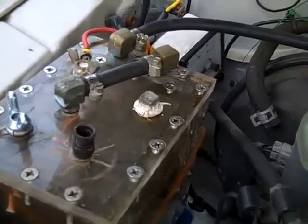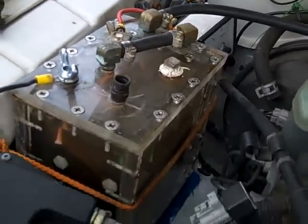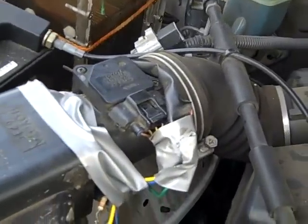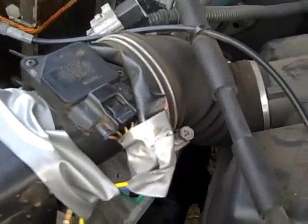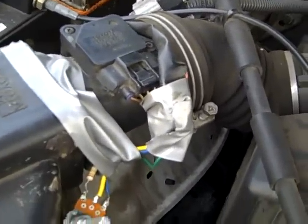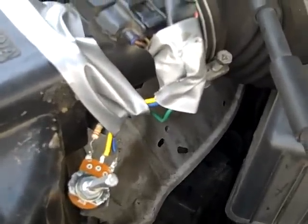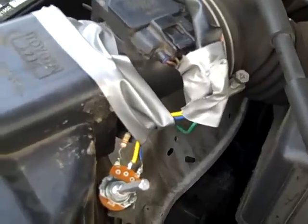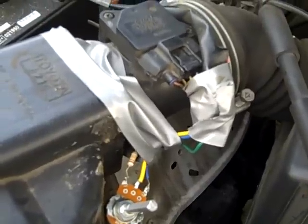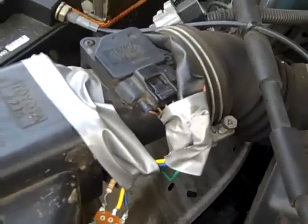And that's where the manual drip would be inserted. Also on this particular version of the car we don't have electronic sensors in the exhaust, so all we have is a pot on the MAF unit which can cut down or increase the degree of air intake accordingly. So that's the main constituents of the unit and we'll fire it up and show you it working.